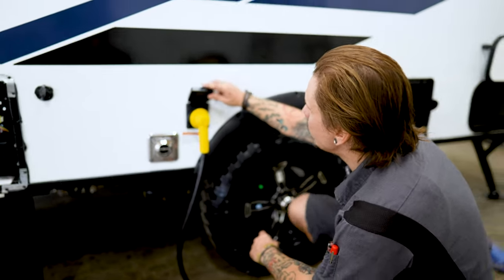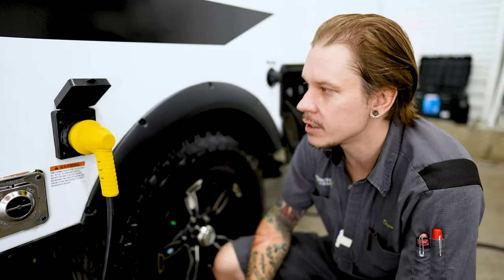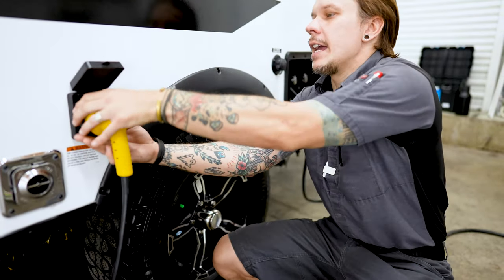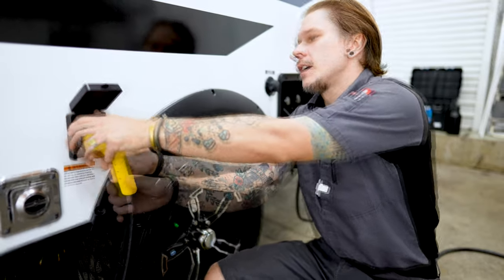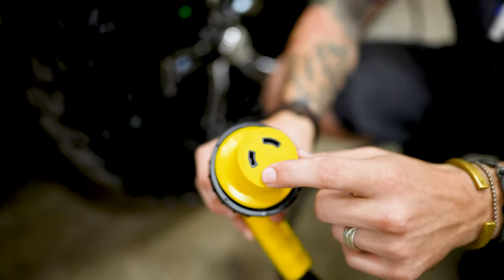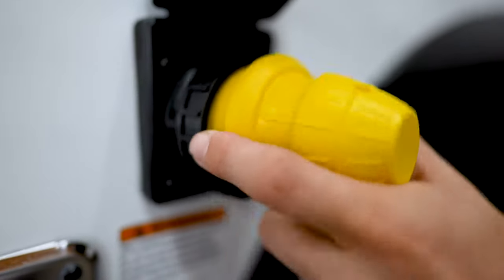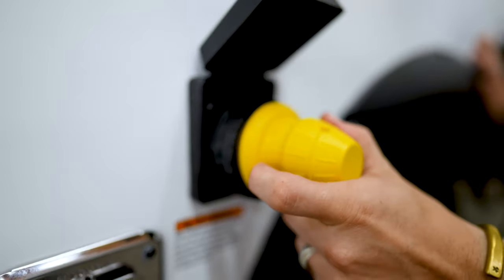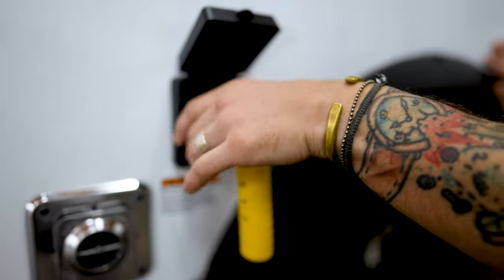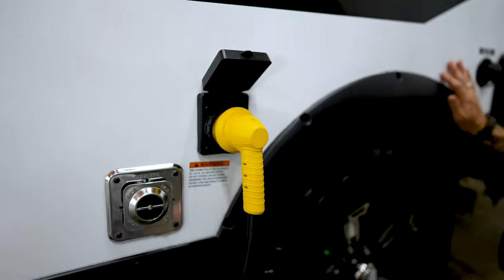Right next to that, we have our 30-amp 110-volt power supply. This is your cord — it comes with the unit, it is 30 feet in length, and it is only going to plug into the camper one way. If we go ahead and unscrew this secondary collar here and take a look at these shapes — we have two slanted receptacles and one L-shaped — we have those corresponding shapes there on the trailer. If I plug straight in, we're going to be right on the money. This does utilize a twist lock connection, so from here I rotate an eighth inch to the right and that locks it in. Then I can go ahead and screw down that secondary collar to secure that connection even further.